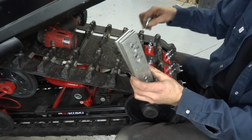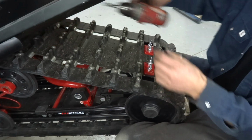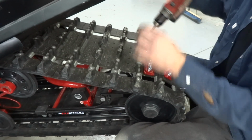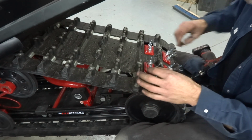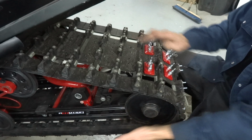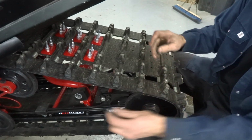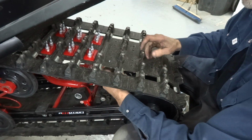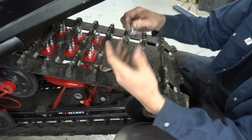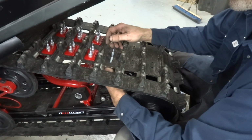When you only have marks, you can't go as fast, that's for sure. You have to take your time and be very aligned on the mark. You can't go fast, bing, bing, bing like that, because you're not going to be very precise in your measurement. Okay, so once you're done, you take your studs and push them through. You could help yourself with pliers to pull them through if you're not able to push them through, but usually it's pretty easy.